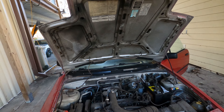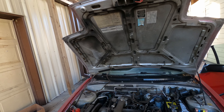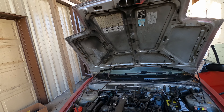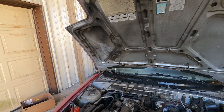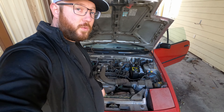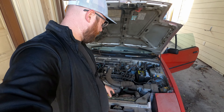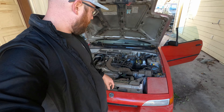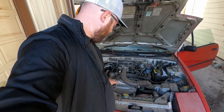Some of this is a little hodgepodge. From what I can tell, it looks like the fuel filter is not inside the bracket, and it's the wrong fuel filter — the guy apparently couldn't find the right one. It's meant for something with quick connect fittings and they used a clamp on it. For the size of the radiator and fan, we're really happy it did not overheat at all. The radiator doesn't go the full length of the bracket here, so we might be able to find one that fits the full length, maybe a little bit thicker, and make our own brackets.